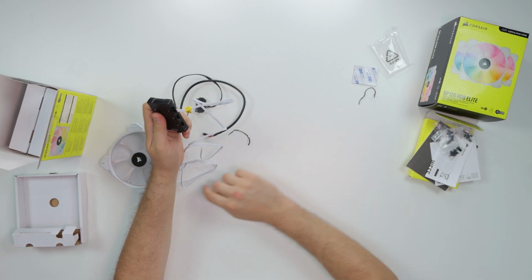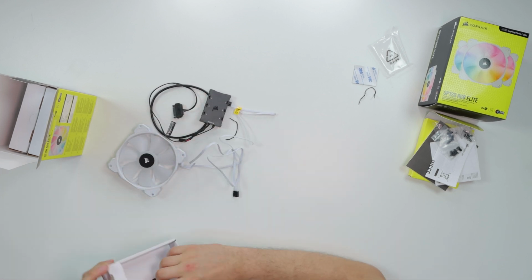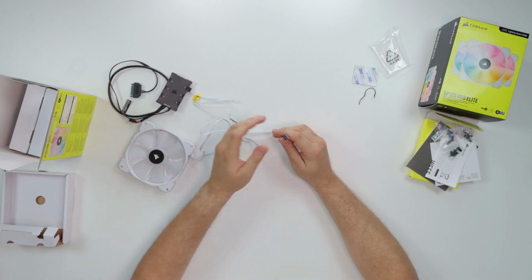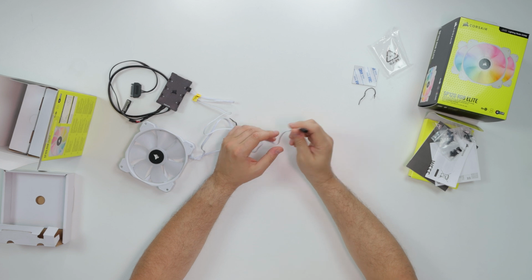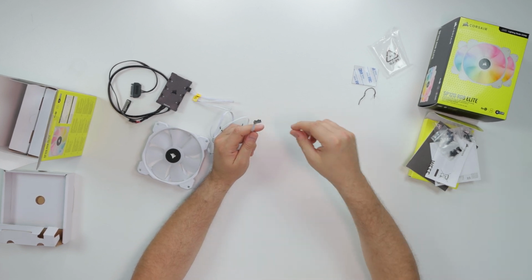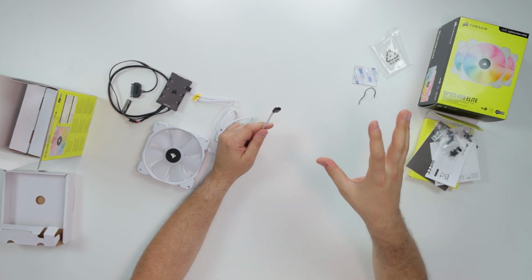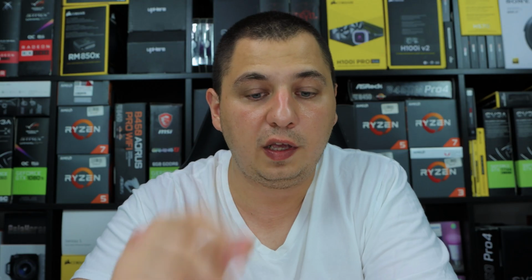And then the best way is, I wish they would have honestly given us fan splitters just to make things easier. Get a fan splitter, you know, 4-way, 5-way, 6-way, whatever way you want, or a fan hub, and then you could plug all these fans into the splitter or the hub, and then plug the other end into your 4-pin PWM header, which you're going to use to control it via your BIOS. That's my best bet.